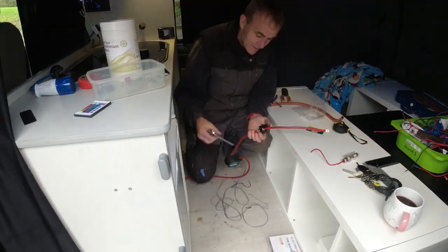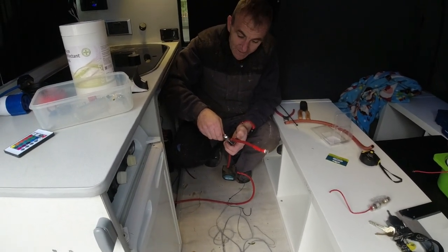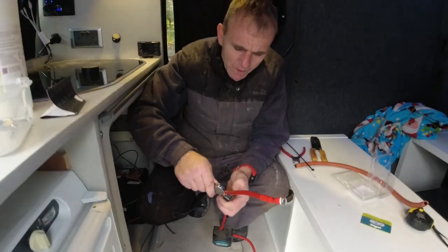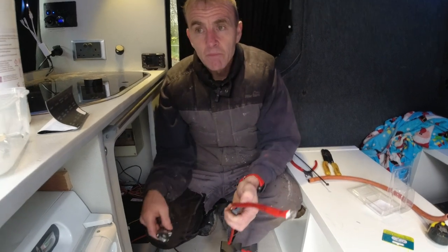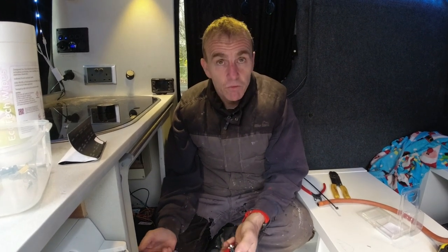Here now, we're on the final phase of electrics now, and he's fitting a split charger in the van. So, Paul, what does a split charger actually do? Right, what it does, it charges the secondary battery, which is your leisure battery. If you've got your fridge and different things running totally off the leisure battery with no alternative charge going into it, it wouldn't be long before the battery went flat. And then when you come to park up, everything would be flat, your lights wouldn't be working.